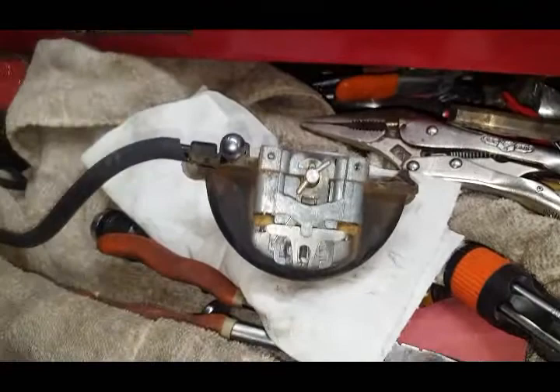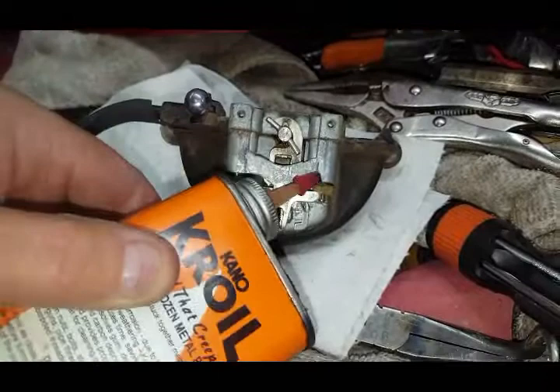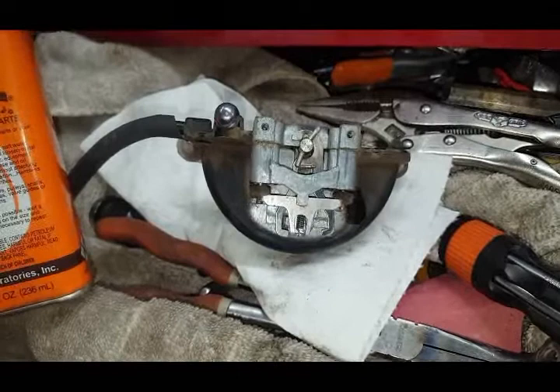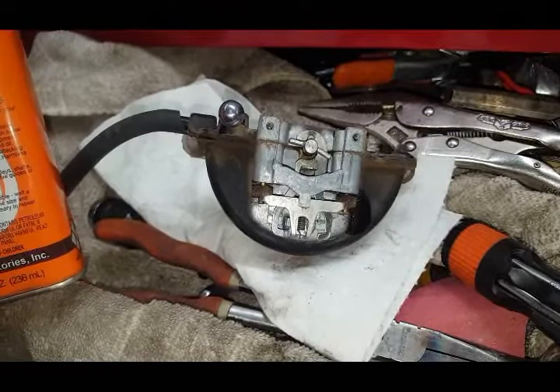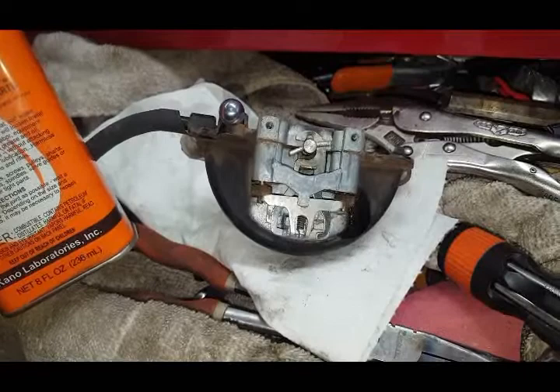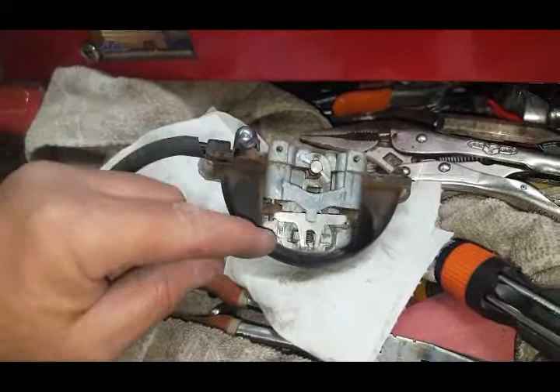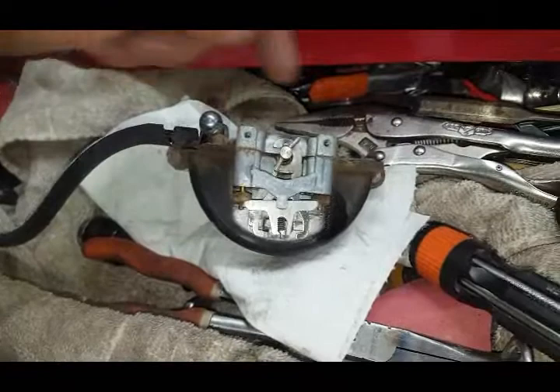See, it barely will move. Using a little can of Croil here. You can see it move the valve over — now it's getting quicker. This is operated off of engine vacuum right here, so you can see how that valve moves back and forth and it allows it to pull on each side of the wiper seal.